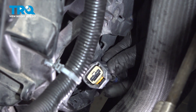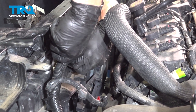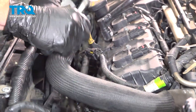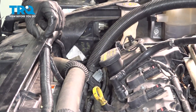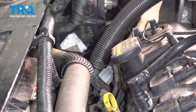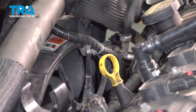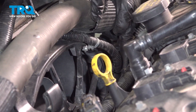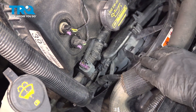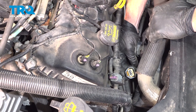Do a quick check for corrosion. Now let's continue following that wiring harness across the top of the fan. The next clips make their way up along here — there are two little tabs you can squeeze in either by hand or with some pliers and pull out of place. Keep making our way down the line. Now we can make our way to that fan connector — press in on that locking tab and pull this out of position. Quick inspection for corrosion.